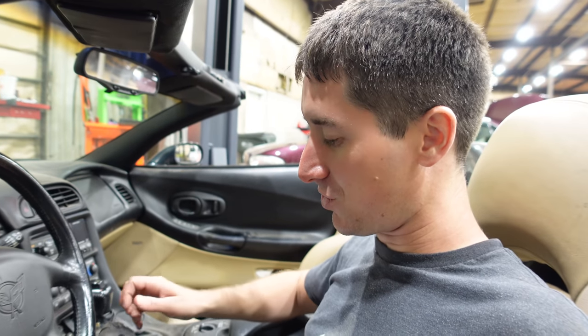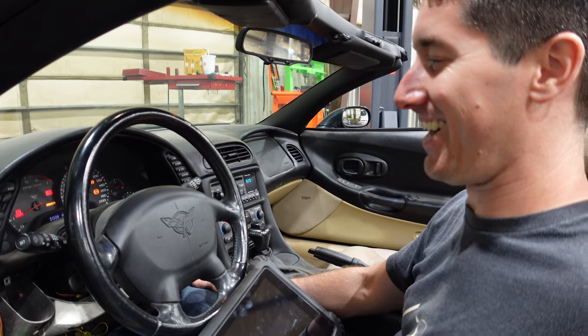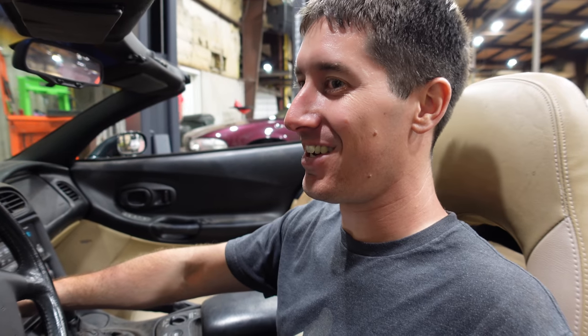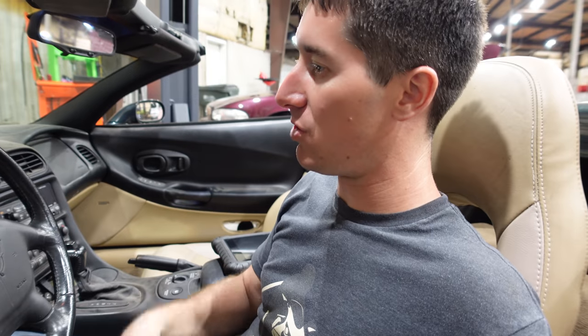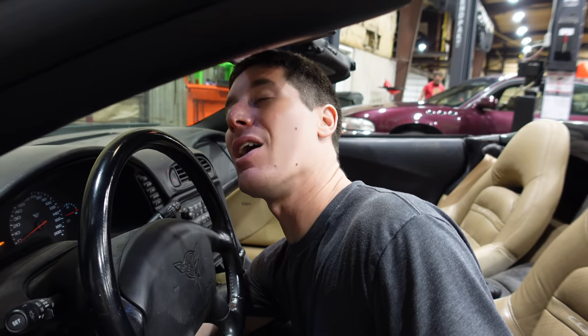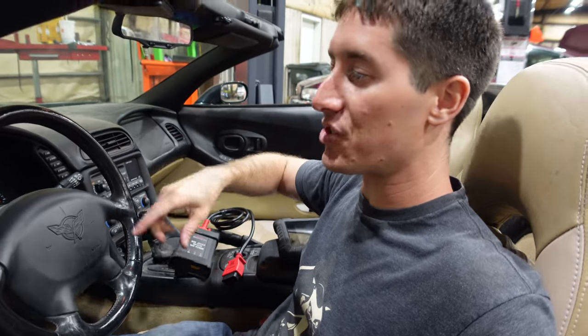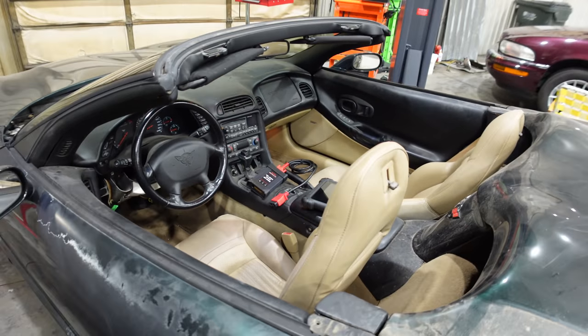It drives and doesn't smell as rich, and it starts amazingly — oh wow, that's way better. Coolant temp started creeping up so we need to re-bleed the cooling system since we pulled coolant lines during the intake job. We still have a high oil temp code that triggers very early after startup and the sensor reading jumps wildly, so that has to be a bad sensor — I'll order one and swap it out on the lift. That's success; we're getting really close on the drivetrain. Thanks for watching — head over to shop.watchjrgo.com for shirts, and please like, share, and subscribe.